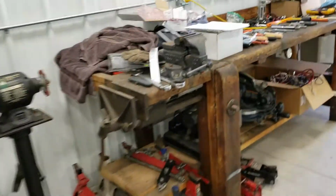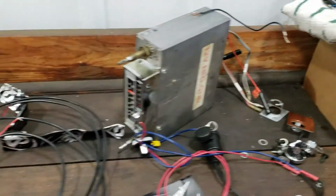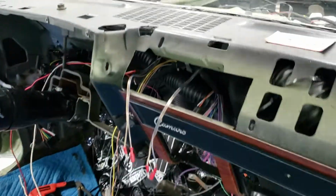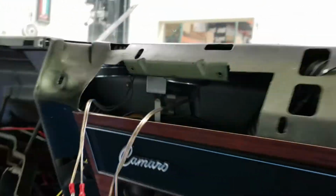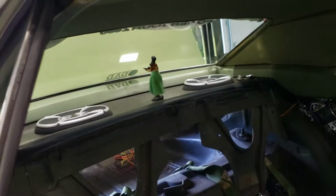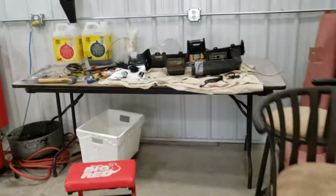And we've sorted out how we're going to wire his dual stereo setup, which he did previously have working, he said. So we've got a nightmare mess of how he wants it all to work. So we will have this cute stereo in the glove box, which is the actual stereo that's hooked up to the subwoofer and everything. But then this aftermarket 8-track player will just play the dual cone speaker in the AM speaker location up there. You'll see he's already got a dual cone in there. So that's where the AM will play. And then the new kick panels have locations for speakers. So there'll be speakers here, and of course he's got different speakers for the deck, but we haven't pulled the deck apart yet. So yeah, and then started kind of working out the Dakota Digital stuff.